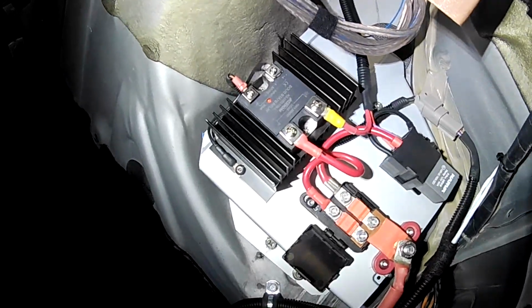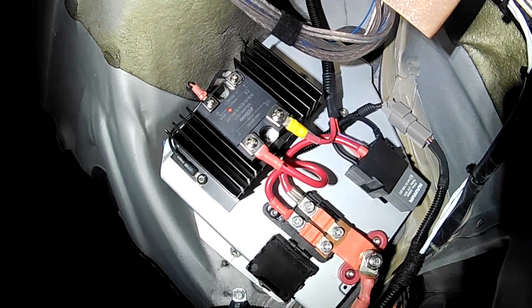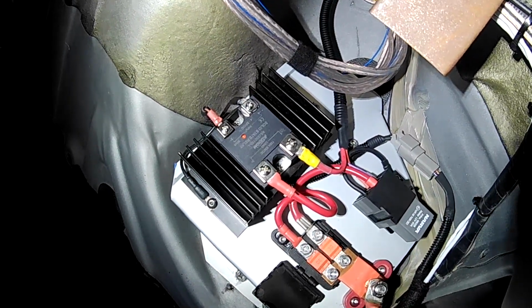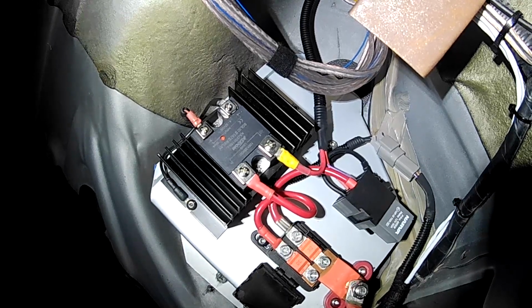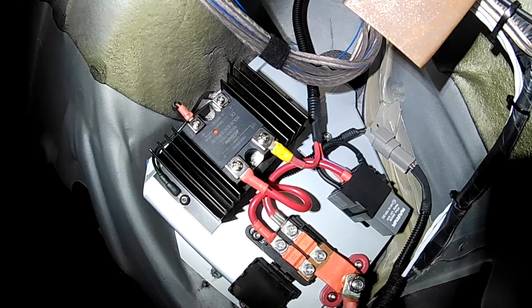So with the solid state relay, it'll be controlling the primary pump. So when you're just driving around normally, it'll be PWM controlled by the ECU, so that I can regulate how much fuel is running through the return system. So you're not pushing a ton of fuel through and heating the fuel up. It's a good way to do it.